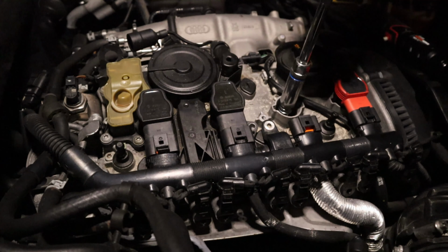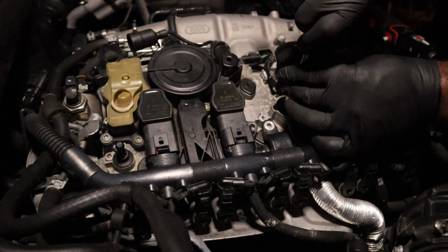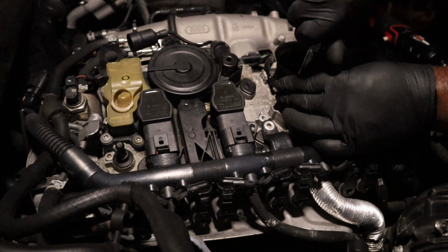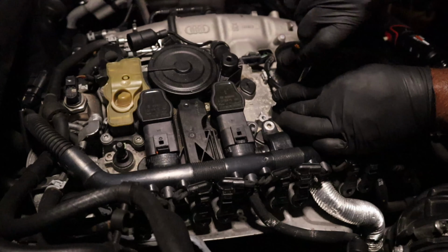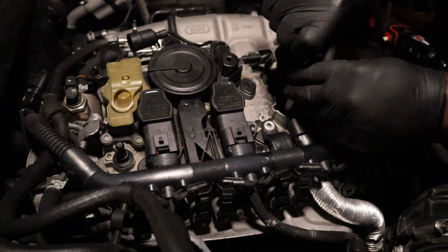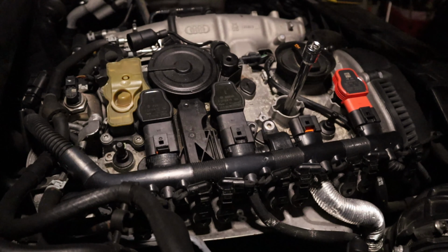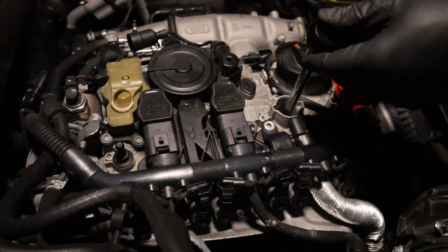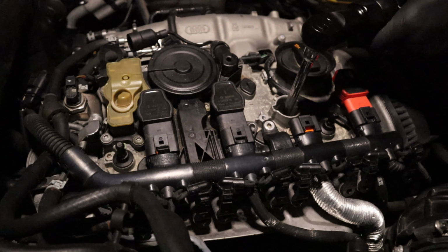Now, if I put them in and I get some misfiring or something like that, okay, yeah, I'll pull them out and check them. But that way, at least it'll point me to which one may be not gapped properly. And I can just deal with that one instead of trying all four. And now I have four plugs that I'm checking and trying to gap and check and gap and check. No. Again, that's just my opinion.